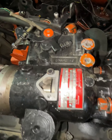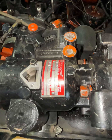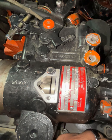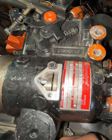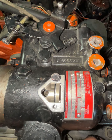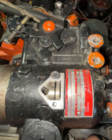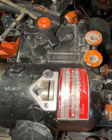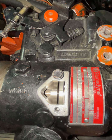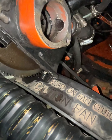If you're trying to adjust this, you can do it while it's still mounted in the engine. But I broke this little fellow off, so I had to pull the whole thing out in order to extract that safely — it came out clean. Down inside this triangle, I believe those are quarter-inch heads. There is a little 5-32nds Allen head right there. You back it out counter-clockwise for less pressure and draw it in clockwise for higher pressure. I've already backed it out. We'll talk about the timing marks — you can see the gouge there — but I wasn't paying attention when I pulled it out, so the timing is probably all jacked up.